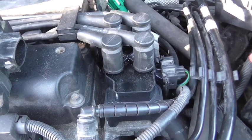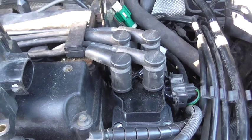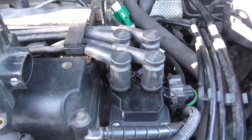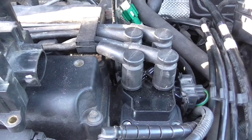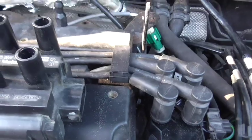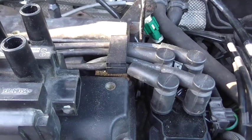To be honest, they all tend to use different ECUs. This particular Fiesta has a Siemens ECU, and lots of the others have different ones, but they all kind of work in the same way - you've got a double-sided coil firing two plugs at a time either way.